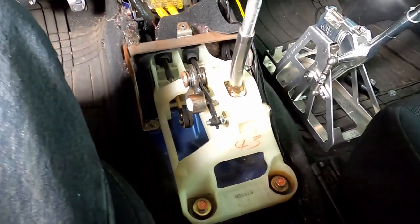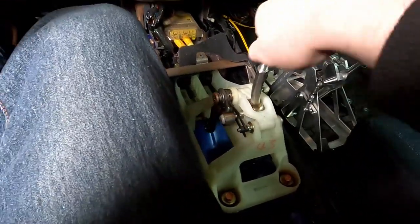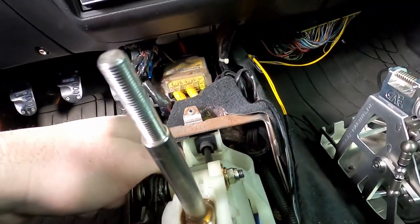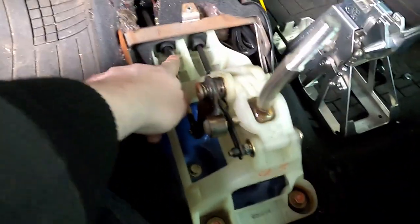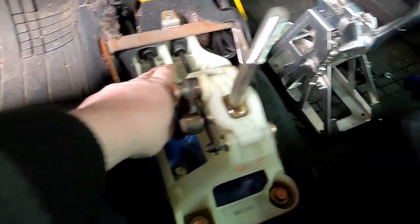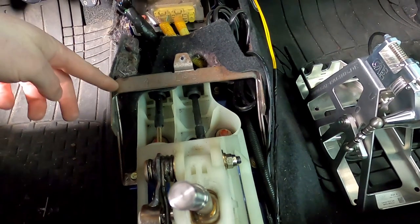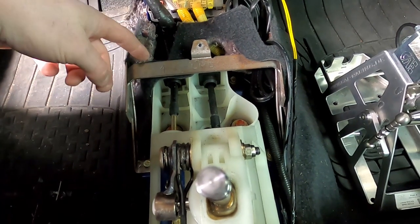This part is going to be the journey for all of us. This is your shifter — right, left, forward, back and forth. You're going to find some weird stuff under here due to previous owners, and that's honestly the worst part about buying Evos these days. I'm going to try to disconnect the cables from this guy and the one underneath. I'll remove and pull these two up out of here, then remove the four bolts — these two right here and these two right here. Probably going to remove this too, just for the ease of installation.